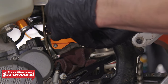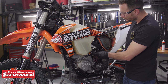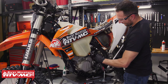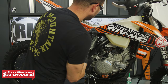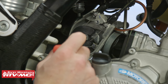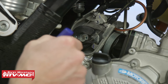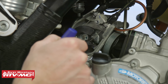Next, loosen the clamp on the air boot and pop the TPS cover off. There's a T20 bolt in the back and T25 bolts for the two front ones. Then remove the TPS sensor — normally I wouldn't recommend this but on this one there's no adjustment we're making. With everything loosened up, swing the subframe up — the air boot might be stuck on the throttle body so you may need a hook tool to push it off. Once the subframe is up, tighten the upper subframe bolts to hold it there. The next step is to measure how far the idle adjustment screw is holding your throttle cam open. I found a 4.5 millimeter Allen with just a slight drag on it — we're taking this measurement so we have a starting point, allowing us to install the new screw to the same height and make adjustments from there.